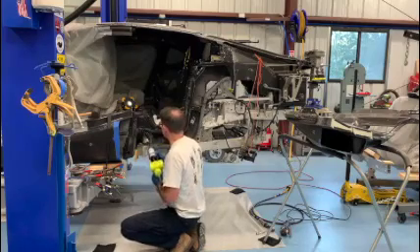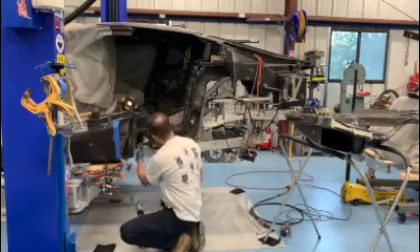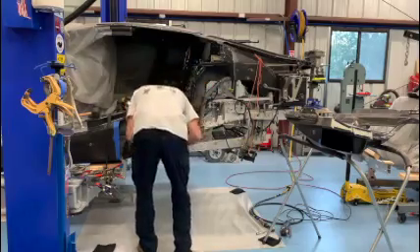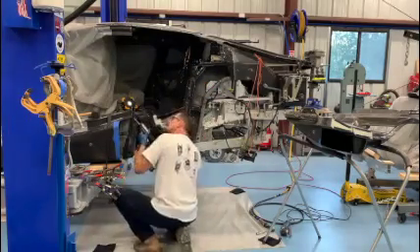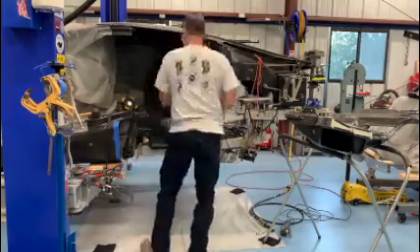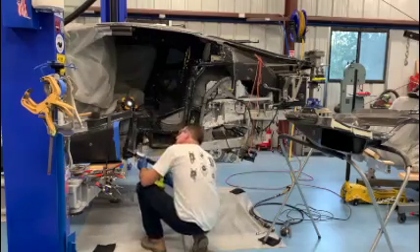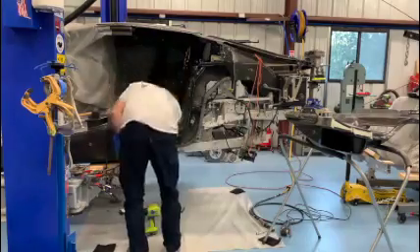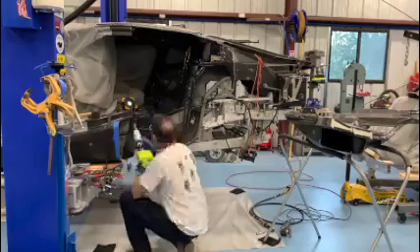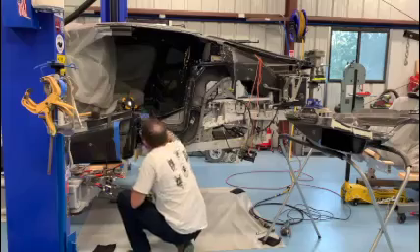What I've been doing is anywhere I have a joint that comes together, I'm sandwiching it with carbon fiber plates on both sides. I've got a lot of extra carbon fiber from the donor tub, so I'm just cutting off little pieces as needed, making bonding plates, and sandwiching those on the inside and outside. In this door jam area where I'm working now, I've got carbon fiber plates already put into place — they've got epoxy on them, they're pushed into place, and they're sticking out ready to receive the quarter panel.